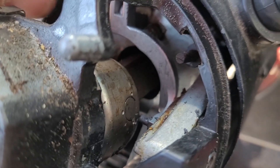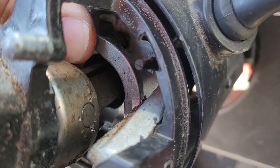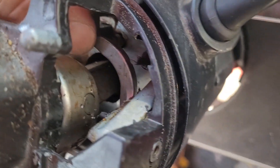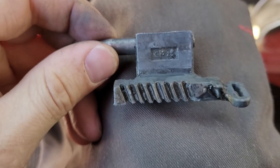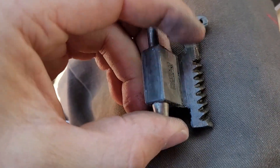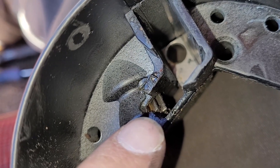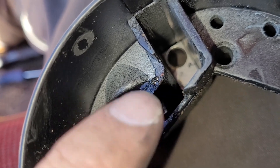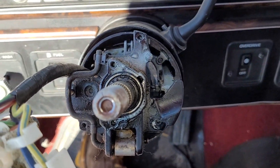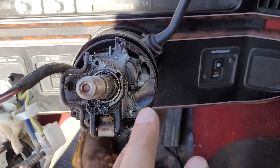I can't completely take it apart without getting more involved than I wanted. But there's a little arm here that pushes on the electronics further down the tilt steering column — that's pretty stiff, not very loose. The teeth on the mechanism don't look too worn or beaten up. There's a spring-loaded piece and a brass gear that goes on the tumbler. I'm going to try and take that out, clean it, and grease it to make sure everything on this upper level is good.